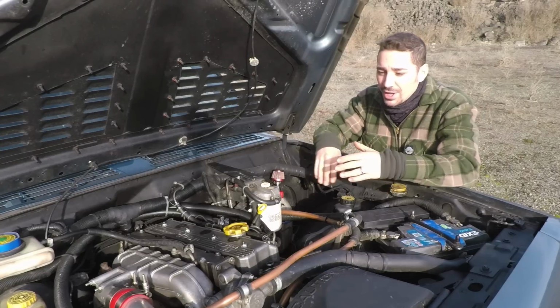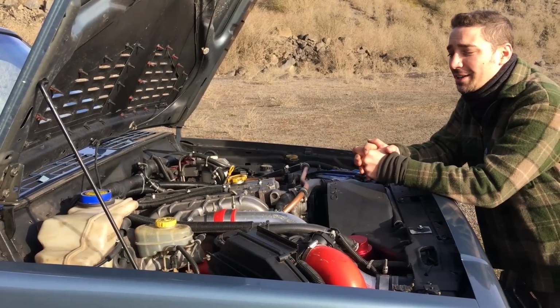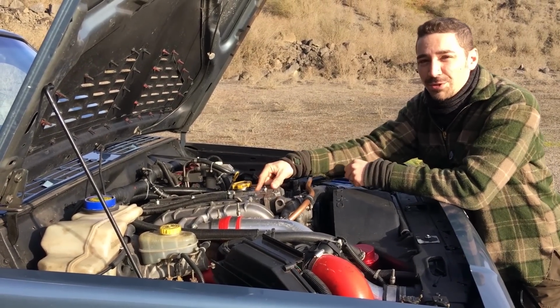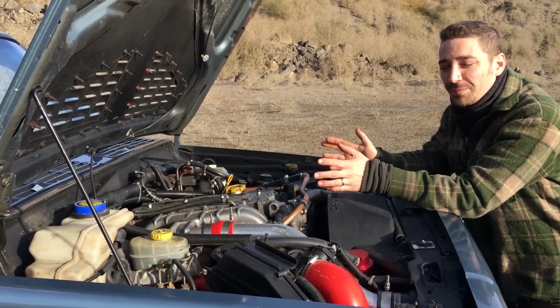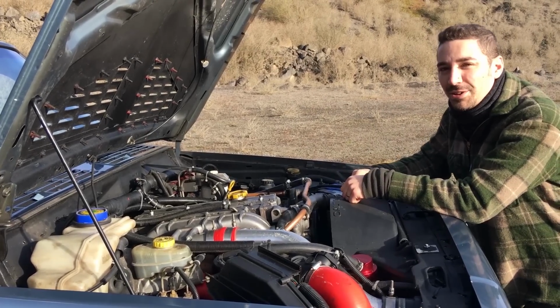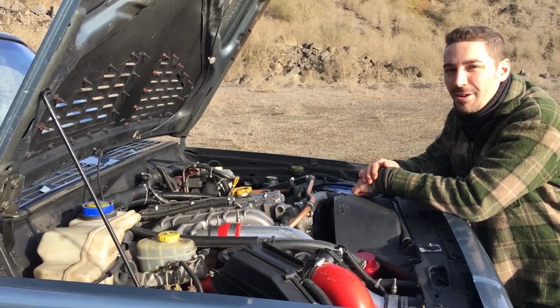I do all the work myself, I can do the rebuild myself and have done, and I had some issues with the cylinder head. Didn't have any head cracking issues, but a stud that holds one of the valve arms on snapped. Snapped clean off on the face of the block. We tried drilling it out, and a friend of mine used an easy out and he snapped the easy out off inside the stud. So we couldn't get that out, tried drilling that out, no good. Even getting around it and picking it out, it just didn't work.